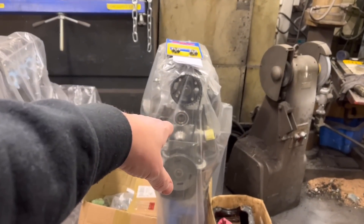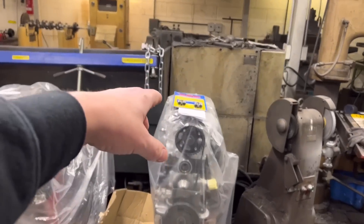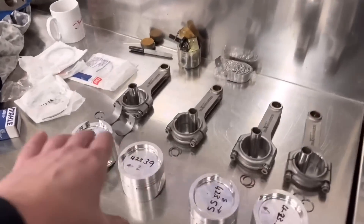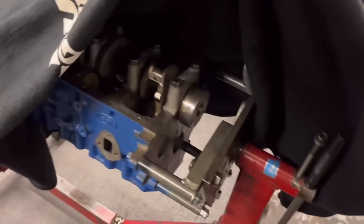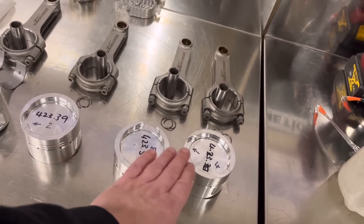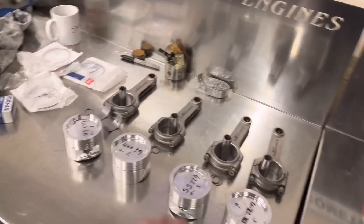We're just going to do the same oil pressure check on the CVH, because these two friends are going to be picking these up in a couple of weeks on a Saturday. Stephen's going to bring in the rocker cover which he's had painted with our name on top - that's going to look really good. We'll get that on video when it turns up. On the crossflow here, Paul's done his measurements and weigh-in. We did a dummy build - put a piston and rod down the hole - and we've got about five thou of protrusion. So I put them in the lathe, took the five thou off so they're flush. Paul's re-weighed them, they're all good, and this thing is ready to be assembled this afternoon.